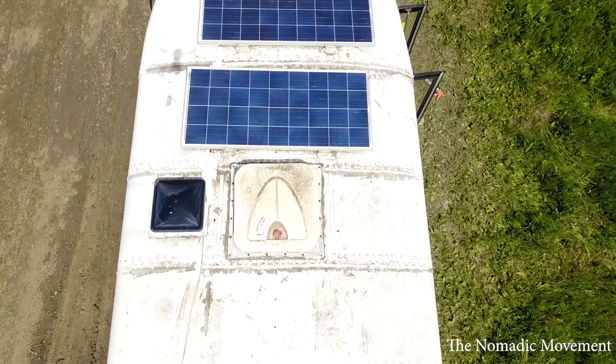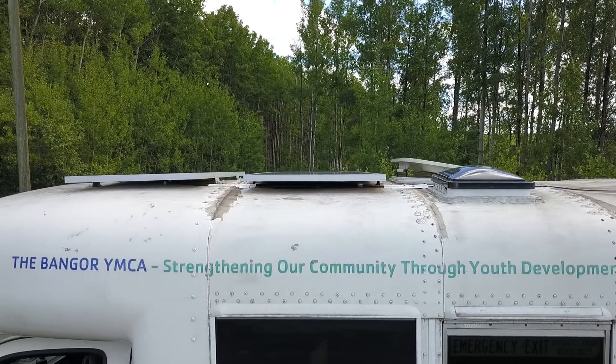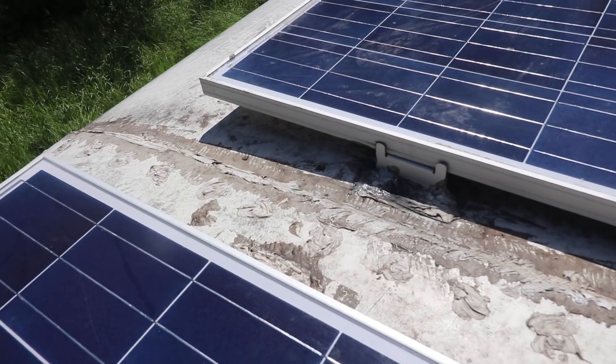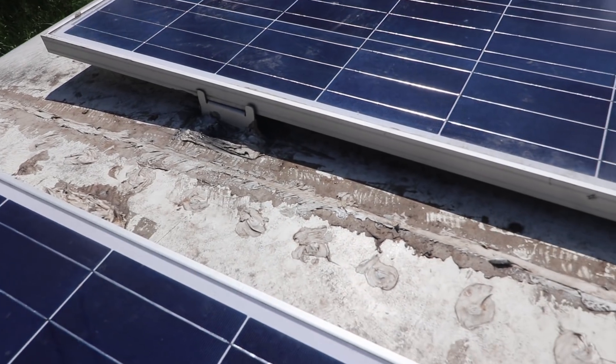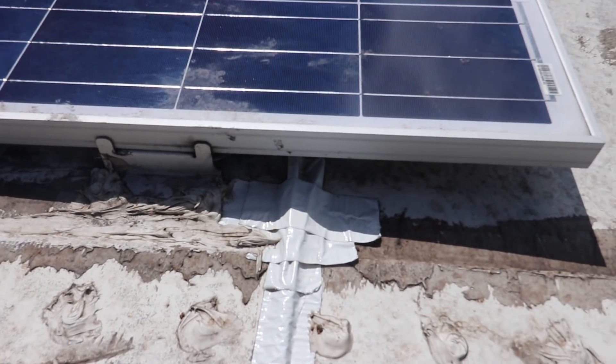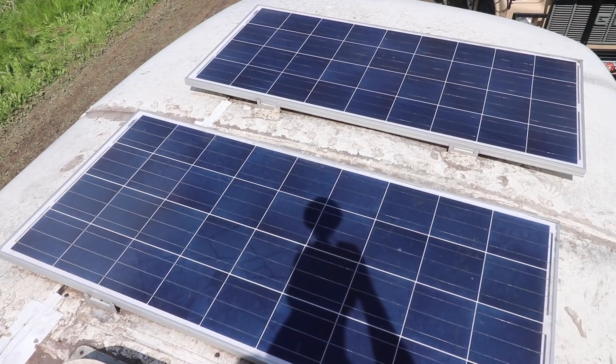The next bus is my friends over at the Nomadic Movement. They mounted their solar panels using blind fasteners where those screws go directly through the sheet metal, open up behind, and hold the panels down with pretty good force. If you notice, they mounted these very close to the rib structures, which gives a much stronger placement. If they had moved them back a couple of inches they would have been on much more flexible sheet metal with a lot more shake while driving. This is a really good option if you don't have the ability to put bolts in or weld beams in.